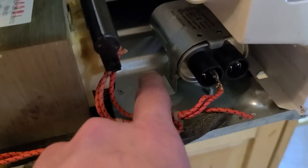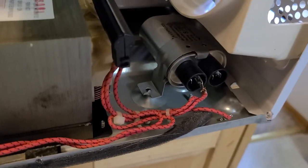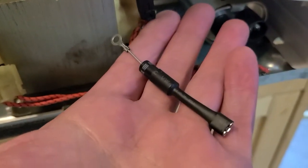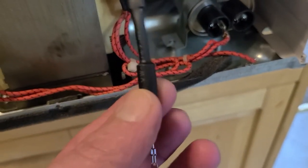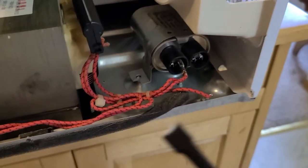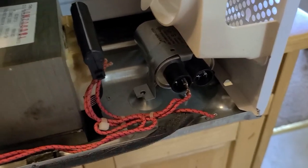Right here, which plugs into here and goes to here, is what they call a high voltage DC rectifying diode. That's what blew up in this — it's bad. I'll show you in the video later how to check for this. At the same time, I'm going to go ahead and replace this capacitor because usually when these go out, it can hurt the capacitor or the capacitor was starting to fail because of that.